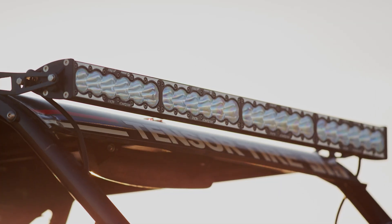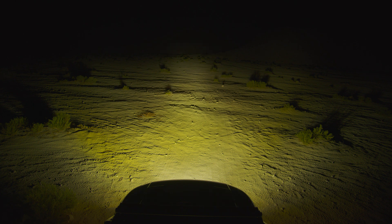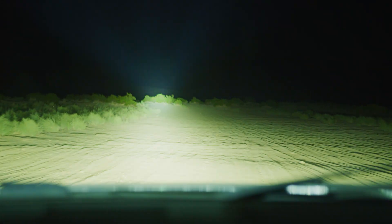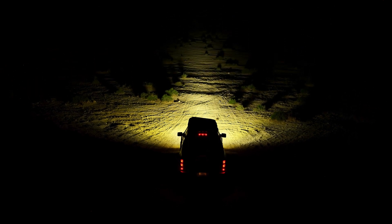And finally, pattern. These lights only use a spot pattern, unless used in our laser hybrid series which combine the best of laser and LED diodes. Because of the extreme tightness of this pattern, we absolutely do not recommend running laser lights without supporting lights. The incredible collected nature of the beams can produce what we refer to as a bouncing ball effect at distance and will cause eye strain and inconsistent illumination. Our Zone 51 laser lights are a complement to your existing spotlighting, not a replacement.